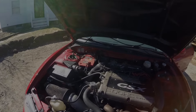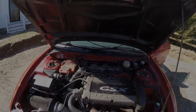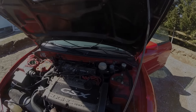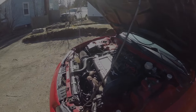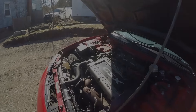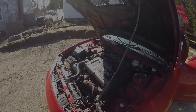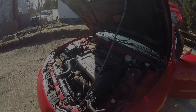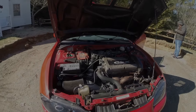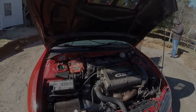I met up with the shop I now work with, Evolving Motorsports. They did a free compression test, and the numbers were pretty low — I think there were two cylinders at 70, one at 50, and one at 90. So I needed a new motor. I searched for a motor, found one in Florida — 7-bolt, ready to drop in. I paid $700, and then $200 for shipping.